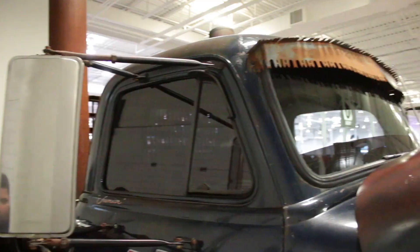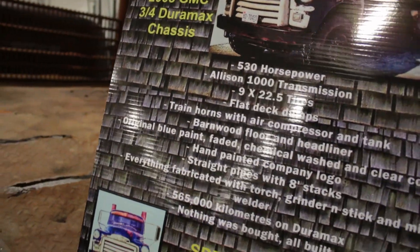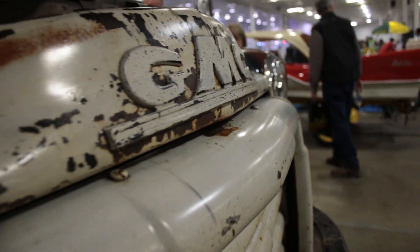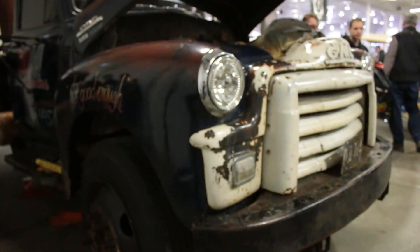It came from a van chassis — only a 250 horsepower Duramax with a 4L80. I roasted that tranny in a very short time, so I put an Allison in. The problem with a van is the wire harness and a truck harness are totally different, so my Allison doesn't talk to that van ECM. You can't pin it either because it's different pins, different connectors — GM is good for that. You'd have to change every sensor, every harness.